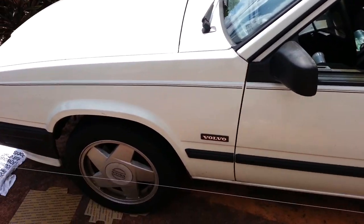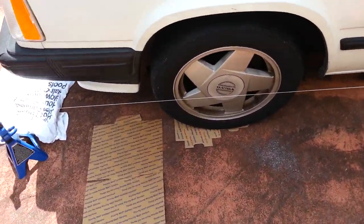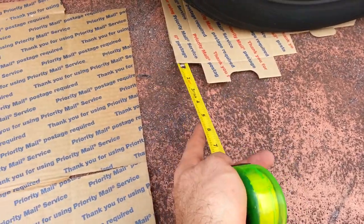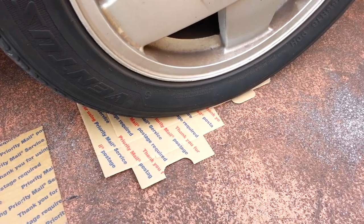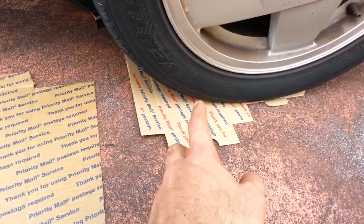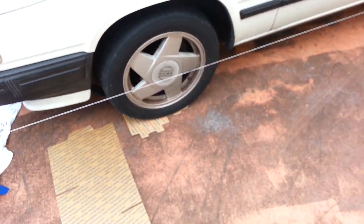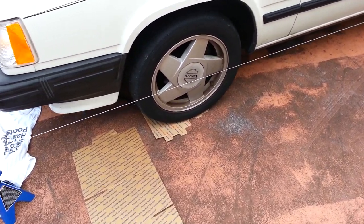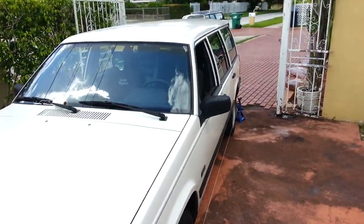I mean, you could ride it like this if you want, if you trust your work. Oh, another thing, when you pull forward, you're going to want to put it on top of, I put on two pieces of cardboard to minimize the friction, so when you adjust the tie rod, it immediately reflects on the wheel. This works okay. Some people use two tiles with grease in between, so it slides really easily. Whatever you do, soapy water on the ground, doesn't matter. You just need it freely moving, and make sure the steering wheel is straight.